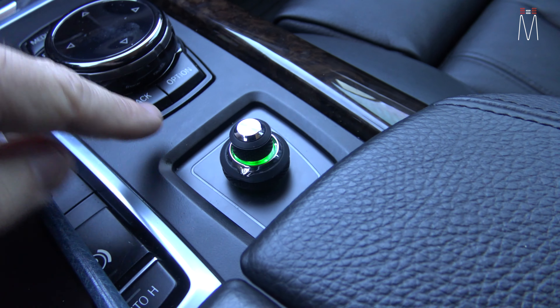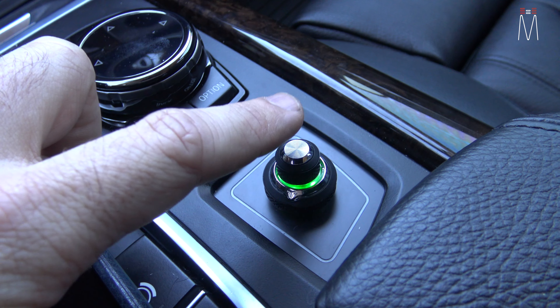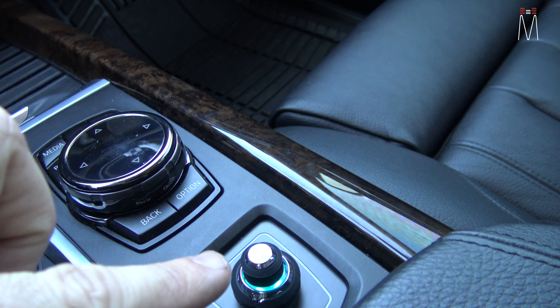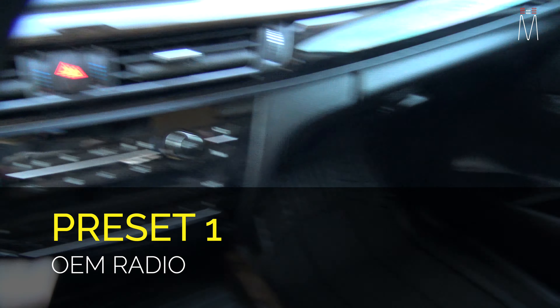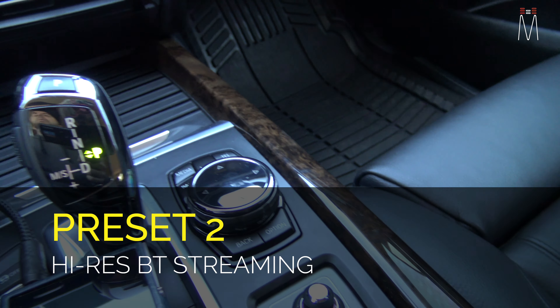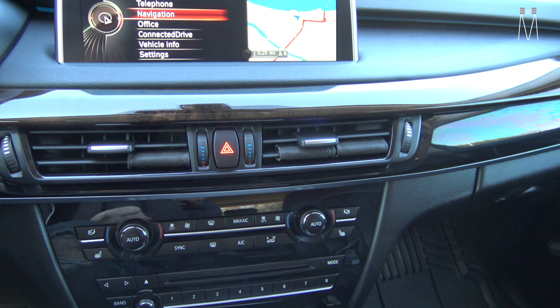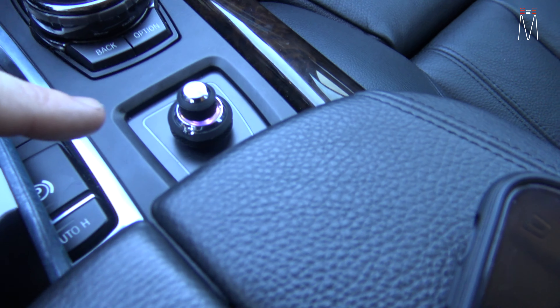This was just a little empty coin tray — we made this panel here and it's our controller for the VXI amplifier. We have three presets. Hit it one time and it turns the factory color — that blue you see on the dash — and it's going to play everything our factory radio is playing. When we hit it one more time, it turns purple, indicating our high-res Bluetooth streaming. If he wants to stream from his phone, it's going to sound substantially better on this preset than running through the factory radio, even if you're plugged in.